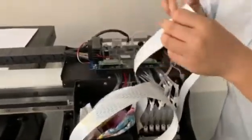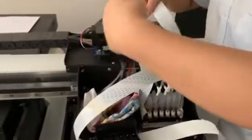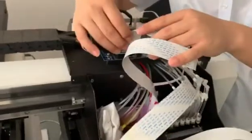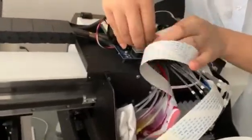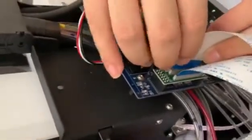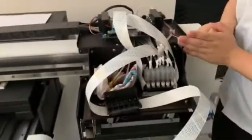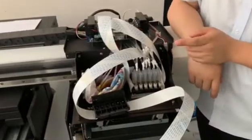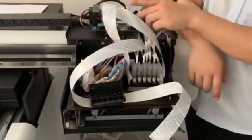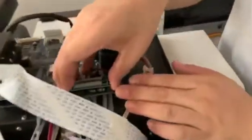In that case, take the white head cable and connect it to the color port. Then turn on the machine. If the white head is now able to print out ink, it means this port — this small part — must have a problem.